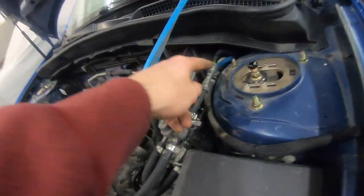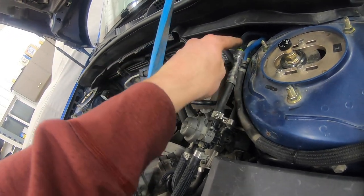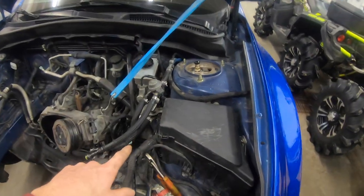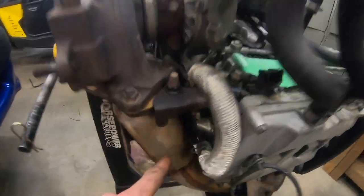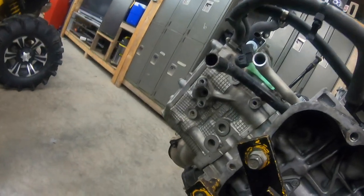So I got this hose vented into my fender. All I did was run this blue hose here, which converts into this black hose. I ran it under my fuel line and just zip tied it to the little ground behind the fuse box there, just to make it look a little bit cleaner. And then I zip tied it to the little vents in your quarter panel there. Now that the Evap stuff's all done, other than this line here for my air pump, once my block off plates come in, I'll be taking off that side here, putting a block off plate there and right there.